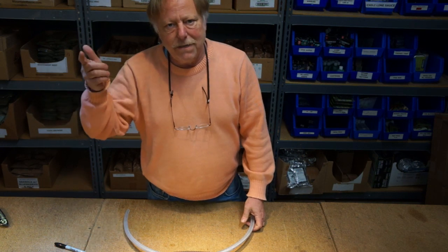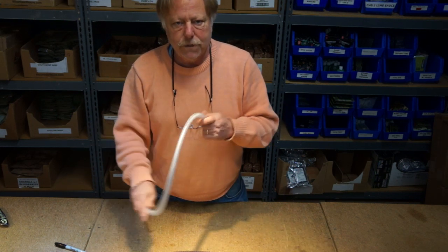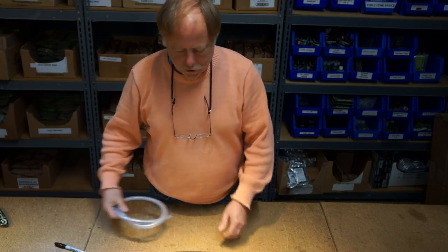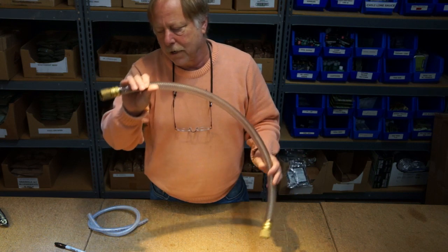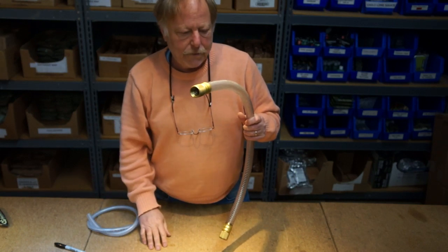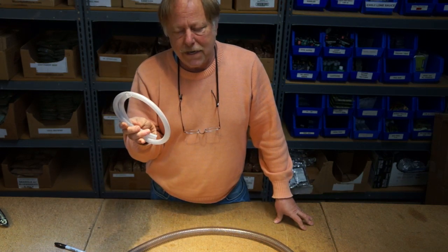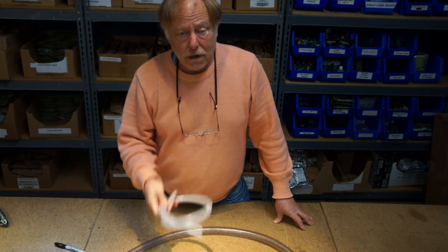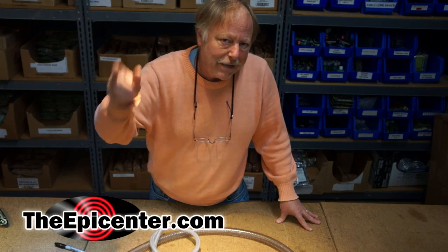Alright, that's about it. Hope that tip helped you guys figure out how to install that hose. These are going to be available from Harvest Right shortly — I'm not sure exactly when, so I'll update the comments as soon as I know. They are going to be making all future hoses like this; the JIC connectors will be made with a 3/8-inch diameter hole in them, and those will be available to purchase if you want to replace the hose. But this little retrofit is very simple to do — definitely do it. I'm doing it to all my hoses. For TheEpicenter.com, I'm Epicenter Brian, signing out.